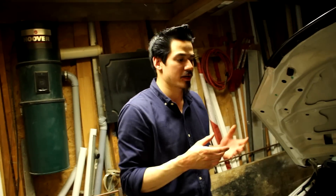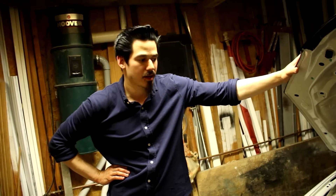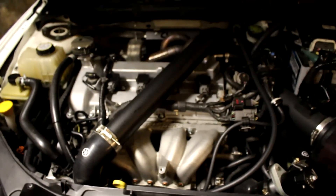Even with all these crankcase pressure relief mods, we're still getting some smoking at wide open throttle only. Also when the engine is a little cold and the piston rings haven't sealed up completely, you get a lot more blow-by — crankcase pressure is higher. It makes sense that crankcase pressure is causing the turbo to smoke. If something isn't explained in the video, leave a comment and we'll get back to you.